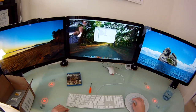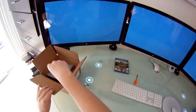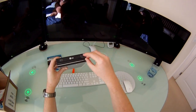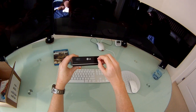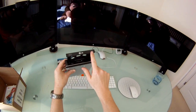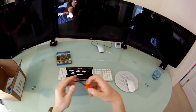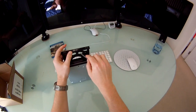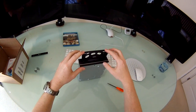First I'm going to shut my Mac down, and while I'm doing that I'm going to prepare my LG Drive. The first thing I'm going to do is remove the little faceplate cover — that's what I'm going to use the pin for. I'm going to pop this drive open, use the pin to drop it open, and remove this plate. This plate is just a little bit too big for the Mac Pro's front doors — it will block it. I use the flat head of the screwdriver to pry the plate off. Lifting it slightly and it comes away just like that. The drive can now close.